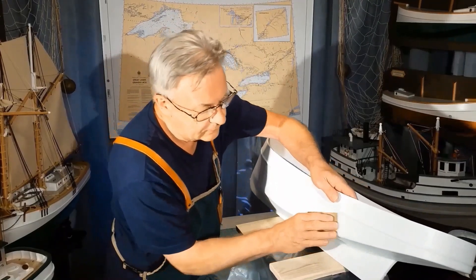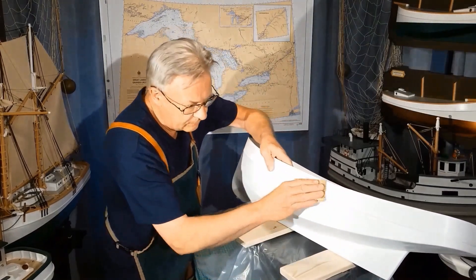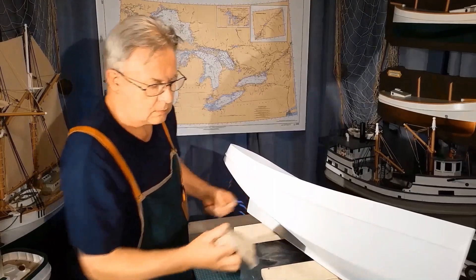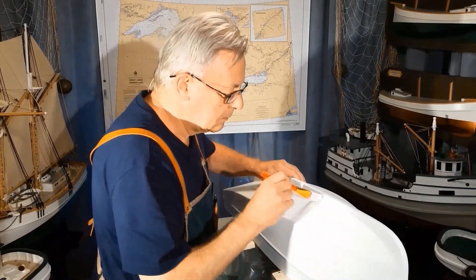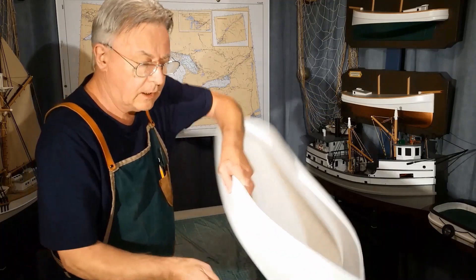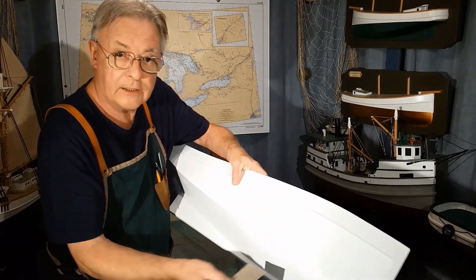The first thing you've got to do is check for any lumps or runs and make note of any spots you may have missed. It looks pretty good. And here we go again. Now we have a hull that's ready to work on. In a few days that latex will be quite hard — it'll take pencil marks for lining out different things. It now has two coats of latex primer sealer on the hull and in the flange. I'm just going to give it a really quick sanding just like that.